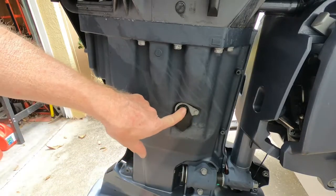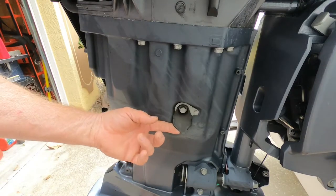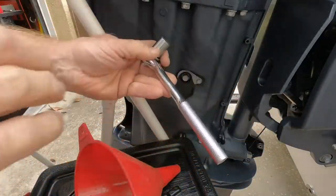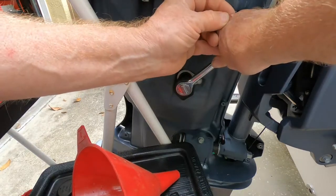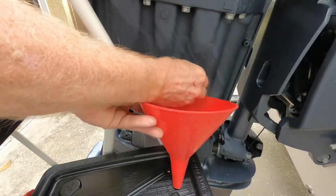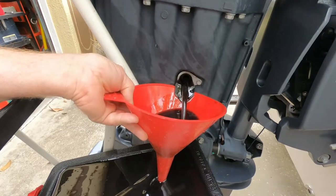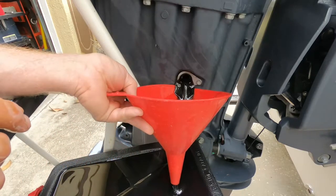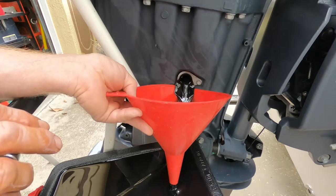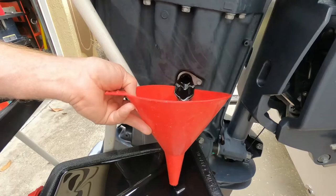This is your oil drain — we're going to take that off. There's a little flapper here so you can put your catch bucket or funnel underneath there. We're using a 14 millimeter socket that fits on there. Just took off some skin — that hurt when the nut released. That was a bit messy; that's why I put the cardboard on the bottom. You can look at your oil too — it looks dark, which is okay. You don't want it to be milky white; if it was a milky white consistency you would definitely have issues where water was getting through the seals. We're going to let that drain real good.